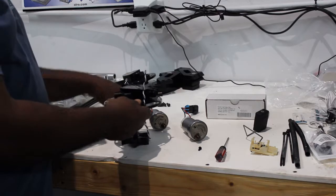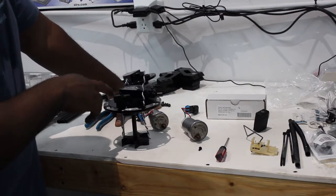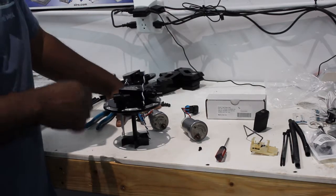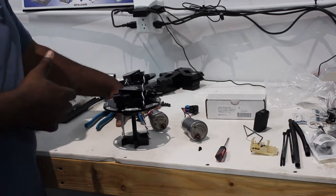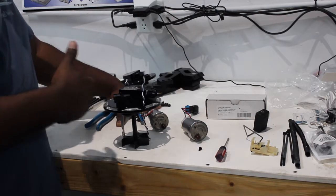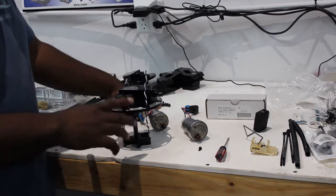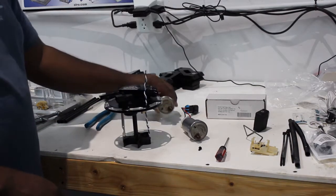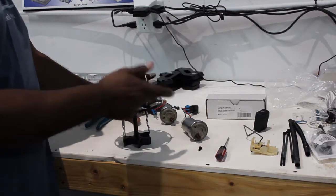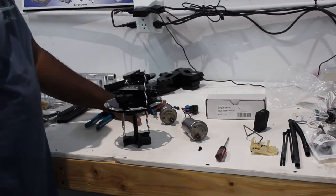Just a brief overview. This is a standard six-pin connector. This allows for individual wiring of each pump, versus a lot of other hangers where you have to share grounds or share signals. This allows you to actually run individual relays, properly supplying the amount of voltage and amperage that each of the high-flow pumps require. And we have a pass-through seal connector, which is all you need to set up the float assembly.